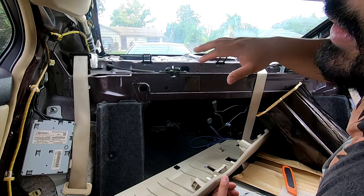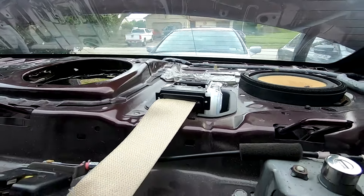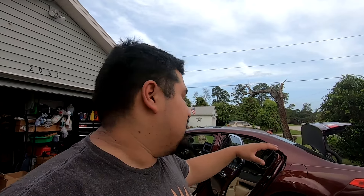I'm going to do the rear deck — I won't show all of it, just how it's applied and what it looks like when done. So far I used one of my sheets; at the top there isn't much going on but underneath is where I'm taking care of most of the sound deadening. When it comes to sound deadening, make sure you pick good thick stuff. You don't need to cover the whole panel — just cover the important parts with your own discretion and stay away from really thin cheap stuff.